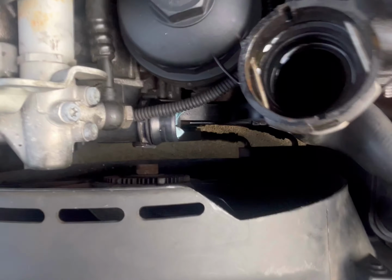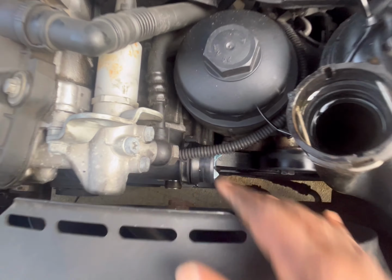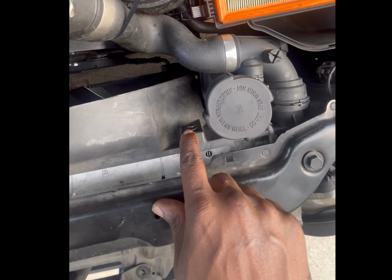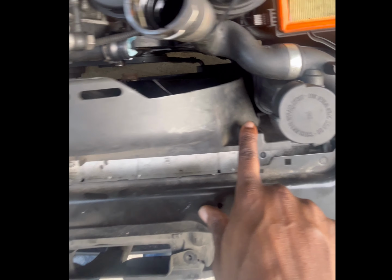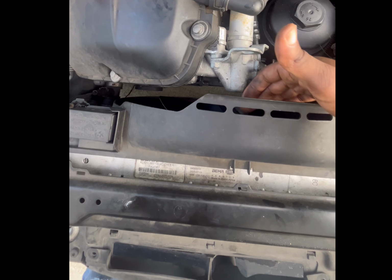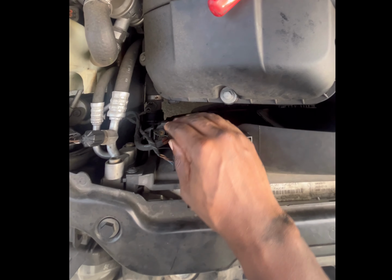All right, so after the clutch fan is loose in here, we're gonna wanna take out this shroud. In order to take this out, you have a tab that's here. Just like the shroud tabs that were up here, you just pull this top part out. You have one over here. This one's actually a Torx, but it's supposed to be one of these tabs. So you just remove these two, and this should all come up. We're gonna show you that here in a second.